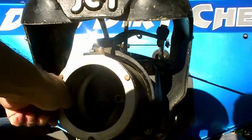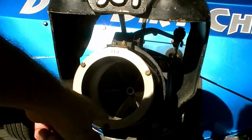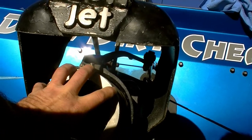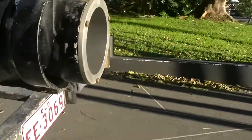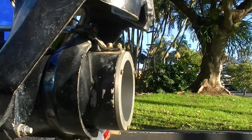That's all the directional play you've got in the nozzle, and you'll be amazed how quickly it turns the boat. The nozzle also has different-sized shims you can put in to increase or decrease the output diameter. It can also be adjusted up or down with screws — along with your shims on the jet, this helps you control how your boat is trimmed.